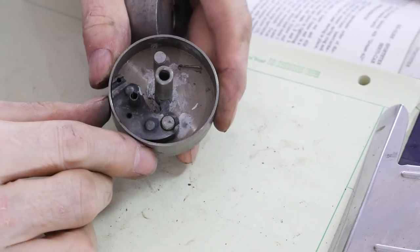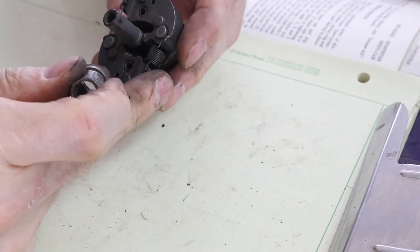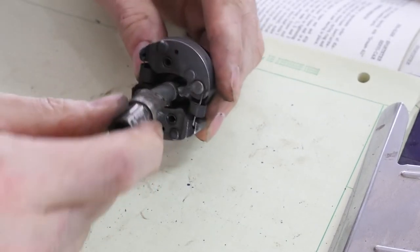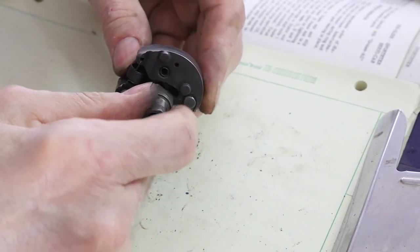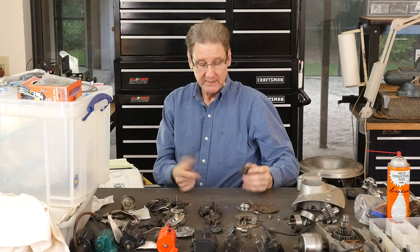Here's one put together — it's meant to take the same outside thing, one of these. I should note this thing — there's a little pin. I think it's on the top side here. That pin dials in with this flat they've cut here, so you don't put it in backwards. See, it didn't go in all the way here. Turn it 180 — now it goes down all the way. Because it matters — it's a 45 degree deal. That's the other thing we should talk about: single and dual fire. These are wasted spark. Factory Harleys are wasted spark.